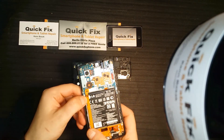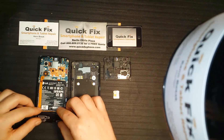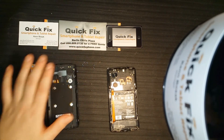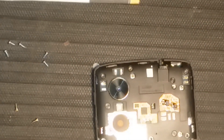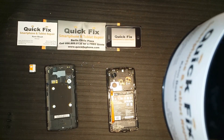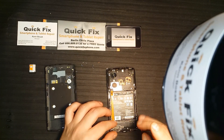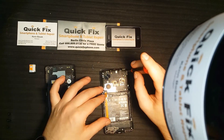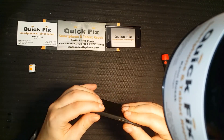Now you want to make sure that these antennas sit in their respective track. If you ever mix up your screws — you can see there's a light blue and more of a silver — those are for the top and these ones are for the bottom. Rebuilding phones for over two years now, I gotta recommend you put the right screw back in the right spot. You don't want to go too deep where a screw shouldn't go and you end up damaging the board. So always put the screws back exactly where they came from.